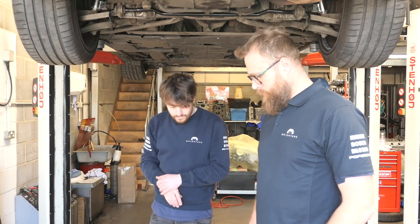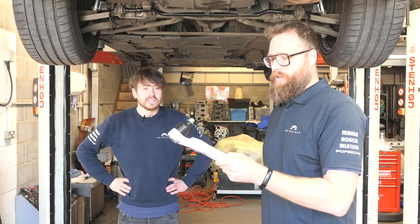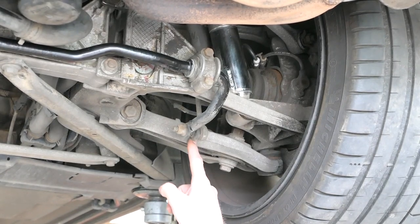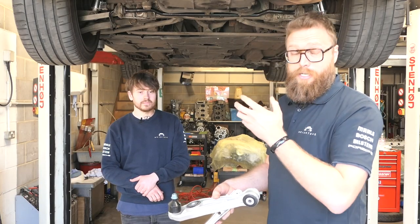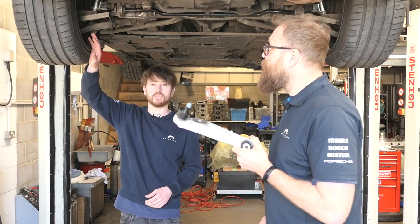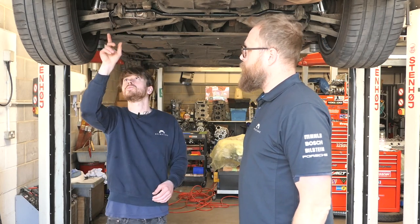There are many parts to this multi-link suspension. Could we talk through each individual component or arm? This is the biggest one — the one that everyone commonly knows on the internet. They call it the coffin arm, or it's the lower wishbone. It's this piece here, and it bolts from the subframe to the hub. Commonly these fail — the bushes fail — and that would normally give you a creaky or squeaky noise. Sometimes the bottom ball joint fails as well, and that can create a knock. It controls the camber of the system, because the camber bolt is what locates to the subframe, and that's what controls the camber.